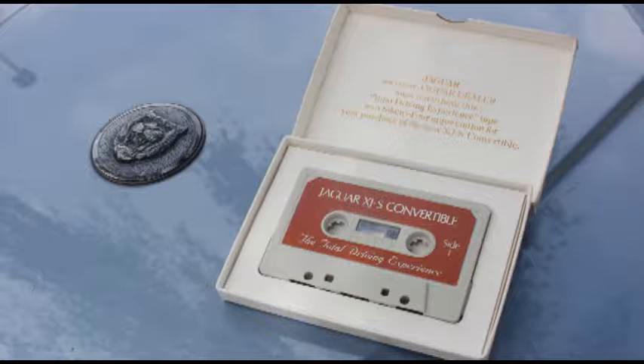The lever for the hood latch is under the dashboard to the left of the steering column. To open the hood, push the lever down. When you close the hood, remember that it should not be slammed shut. With one hand, apply light downward pressure to the center of the hood until it gently rests on its closing latches. Secure the hood by pulling the lever under the dashboard toward you.